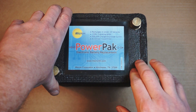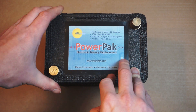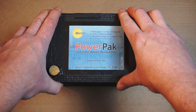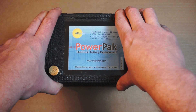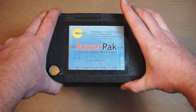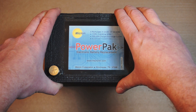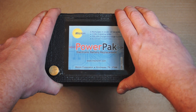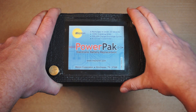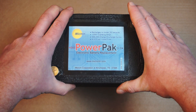Now these guys are really cool. I contacted them after I got the thing and had some discussions, because I plan to have some fun with this before it goes in the car — we're going to try welding with it and everything else. The benefit of super capacitors is they don't store a lot of energy compared to a lead acid battery, but what they do store they can deliver in tremendous bursts because they have very low internal resistance. The battery in the car has around 660 cold cranking amps; this thing has 1,500 plus and it weighs about a third of what the battery weighs — around 11 pounds.